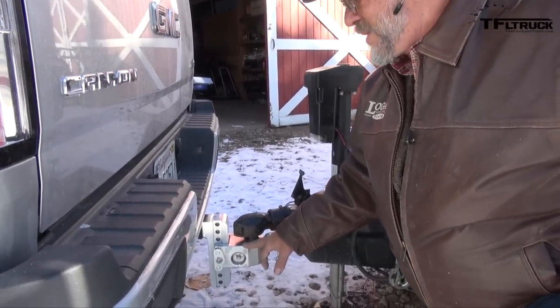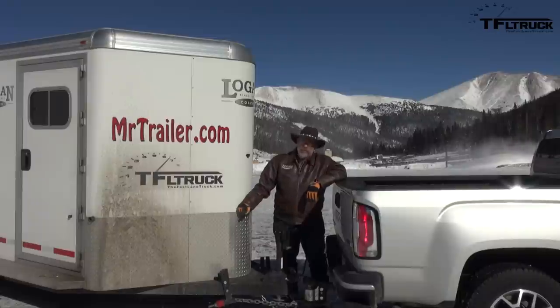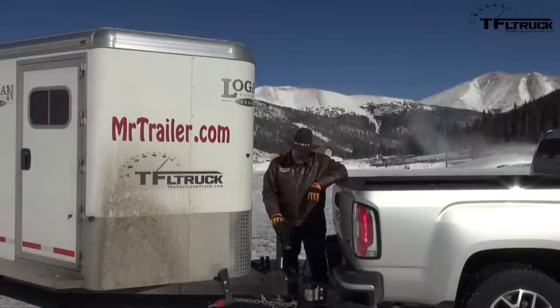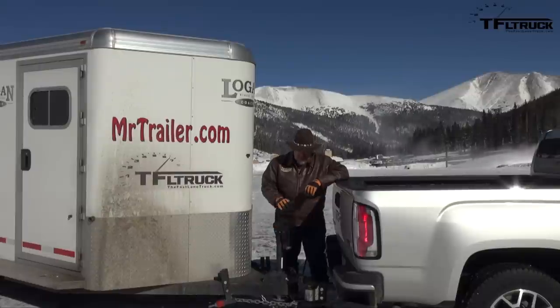These folks are at way-safe.com. We're towing trailers with the Fastlane truck and we're always into safety, so we have a weight distributing hitch on this. When we started this project this morning we used the WaySafe hitch to get our tongue weight and now we know we're right at 10%. But this is a class 3 hitch — this GMC truck requires that over 5,000 pounds you use a weight distributing hitch, so we put on an Anderson weight distributing hitch. We've also got our Ultra-Fab jack here which makes it easier to put all this stuff in, and we want everything balanced and safe for the trailer coming up and down this big hill.